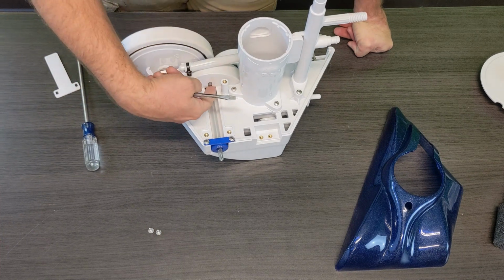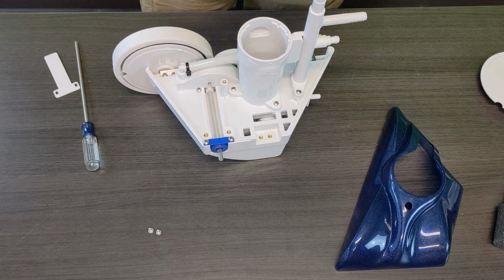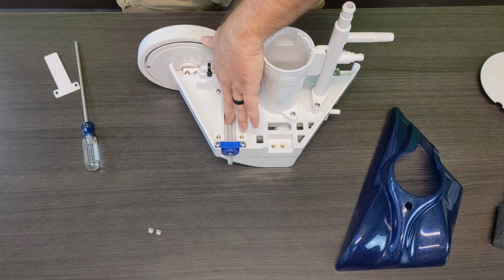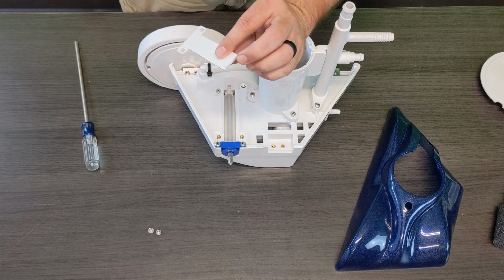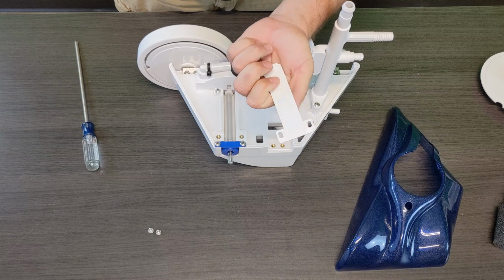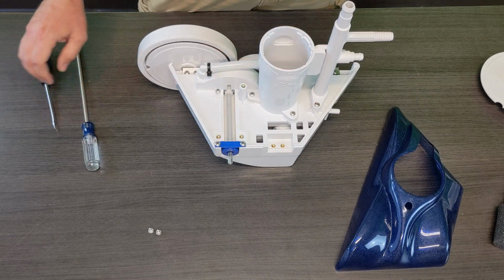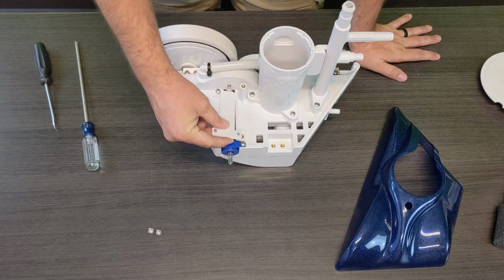So it will not allow you to get into the actual turbine. To do that, you have to remove the turbine cover, which will be another video, so make sure you check out the playlist in the description so you can see if that's the part that you're looking for here. But for this video, we're just going to show you and talk to you about the cover and how important it can be in making sure that this cleaner operates. As you can see, it's just a thin piece of plastic, but it does seal on here really well.